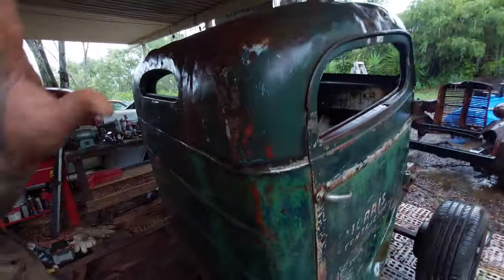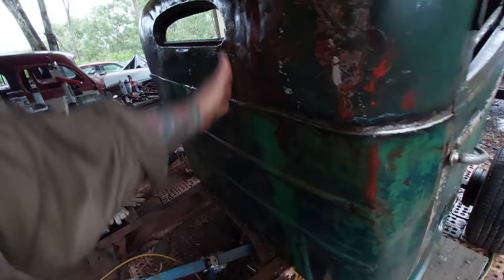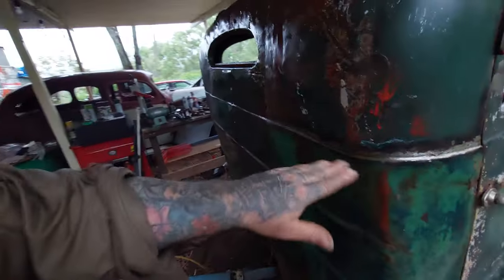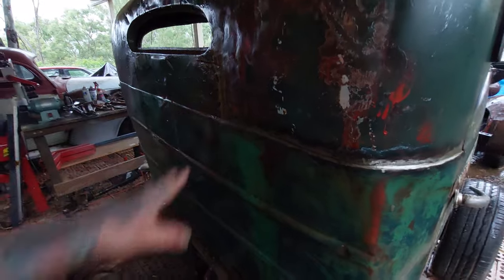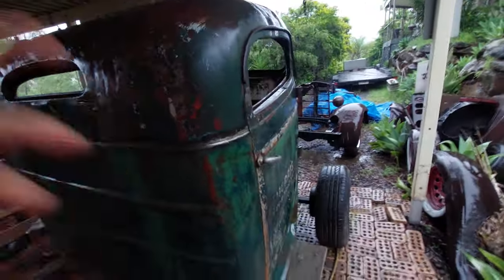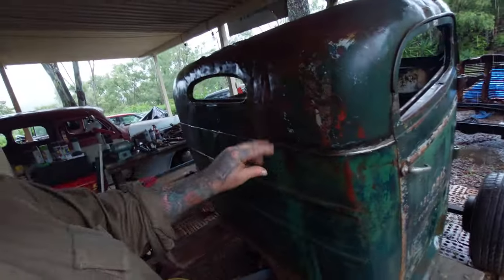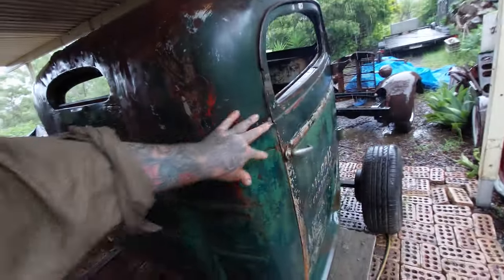Our next step will be to do our patina blend. Yes, that's right, our next step will be to paint all our weld marks. Now what we will do here is we will hit this with a hammer tone brown that I have. It's a copper colored hammer tone brown. We'll put our first little bit on that, then we will spray some water, and we've got two other browns. We've got an Indian red, which is like a reddish brown, and basically a mission brown that we will just put some random bits on just to get that brown as our bit of rust.